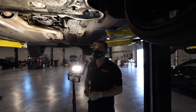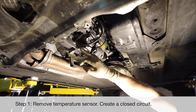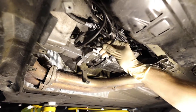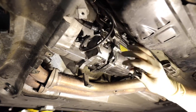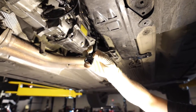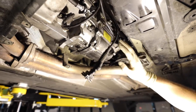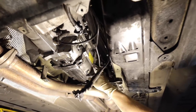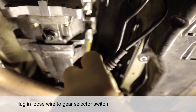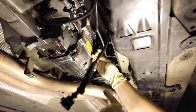On the SMG we have a temperature sensor that is no longer used on a manual transmission. It's going to be right here in the bell housing — this is the harness we're going to use for the actual gear selector switch. All you have to do is unplug it; there's no use for it because this wiring used to go to the SMG module. If you already did the conversion, the SMG module is unplugged. You should have a gear selector switch installed all the way in the back of the transmission with a plug hanging for it, so you're going to plug this connector into the gear selector switch.